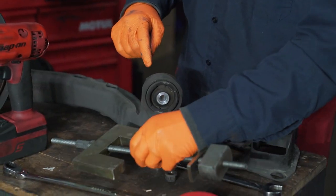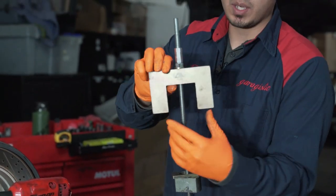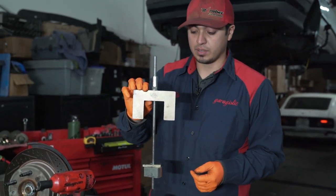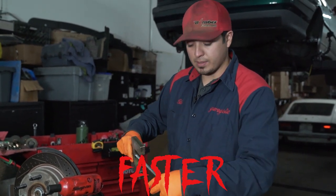The way I'm actually going to remove the bushing, I'm using CTA Specialty Tool number 7642. This is meant specifically for E36 and E46 trailing arm bushings — you can remove and install with it. I highly recommend you get it.